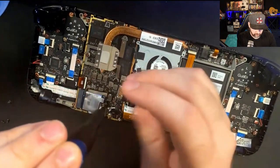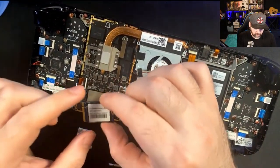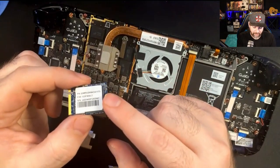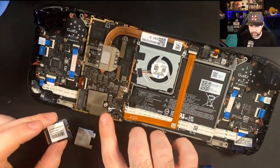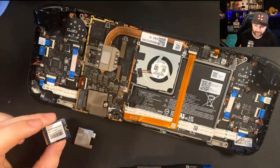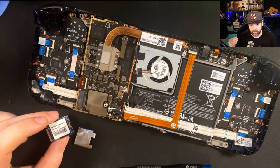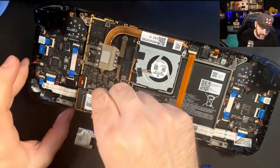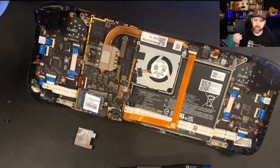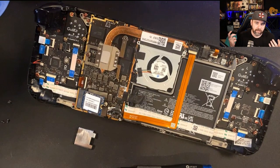Right here is another screw holding down the drive. You can unscrew the drive, take the shield off, and take the drive out — you'll see it is really small. I wouldn't recommend installing anything other than a 2230 into the slot. There are ways to get a 2242 or a chopped 2280 in here, but I highly recommend not doing it, especially if you're newer to this. Just pull this out, get your other SSD in there, and drop it in. I'll have links in the description to the iFixit toolkit and an SSD that I've already installed and that worked fine in my other deck.